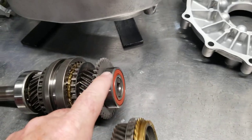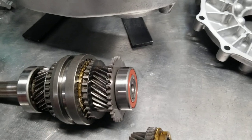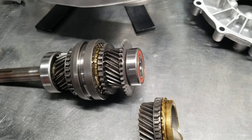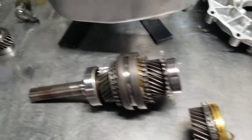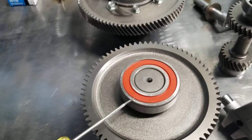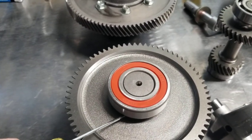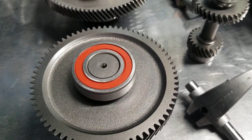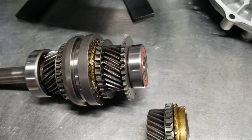We're updating this one to the sealed bearing. There was a little bit of debate for a while — people were calling me asking whether they should use the sealed bearing or not. Because the Club Car engineers are using the sealed bearing, that's what they suggest, and that's what I put there. In other locations you don't want to run it sealed, but in this particular spot the engineers have, so we do.